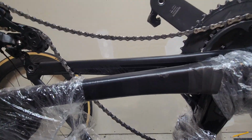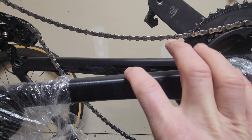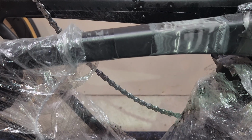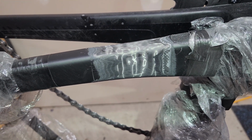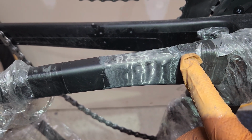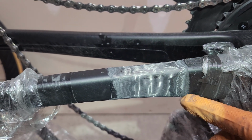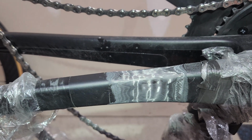But I have black taped it so that the area is only between here and here that I'll be working on. So I'll be sanding all the way down here and all the way over here, getting this down to the rough carbon, and then once I do that, we'll start working on the epoxy. So it does take a significant amount of sanding with the 120 grit to get it down to that bare carbon. I would recommend that when you tape, I think it said it in the directions, but I'm not quite sure, you don't tape from here to there, you tape from here to there. That way when you want to unwrap it and get to the affected area, it's a whole lot easier. I went the opposite, I went from here to here, so I had to really pick at it to come back out to see where I was at.